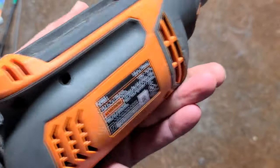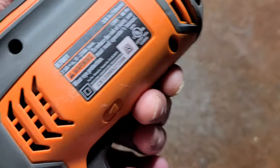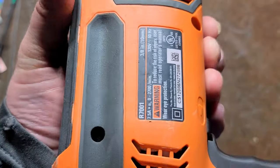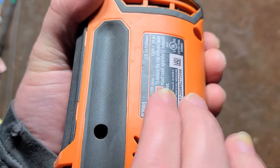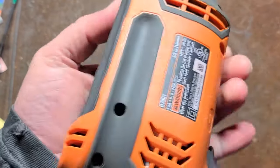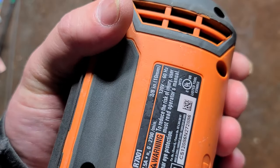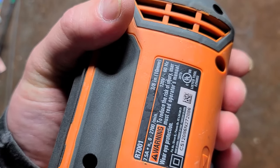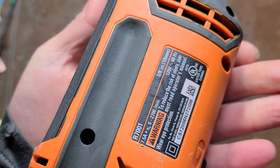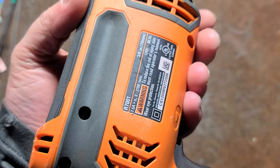There's a little bit of rattling. If we squeeze the case, that's the field. All these plastic clamshell drills have issues where the plastic gets just a little bit worn — and this drill is like new, too — and then the field can rattle. So if I squeeze the case it sounds great, but release the case and there's a little bit of rattling. That's a bit of a disappointment.